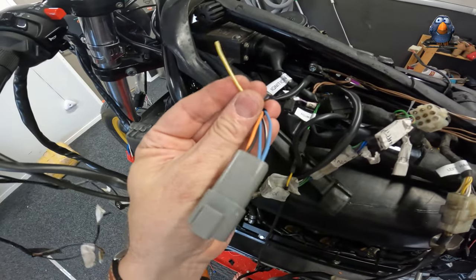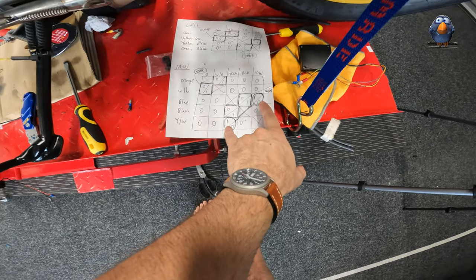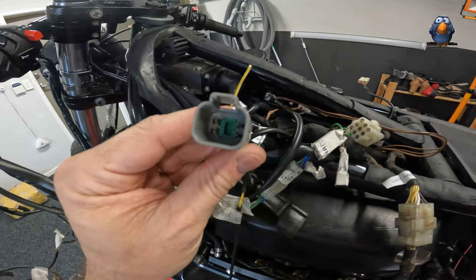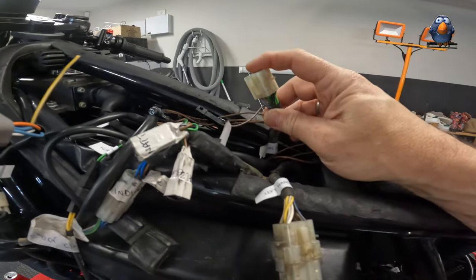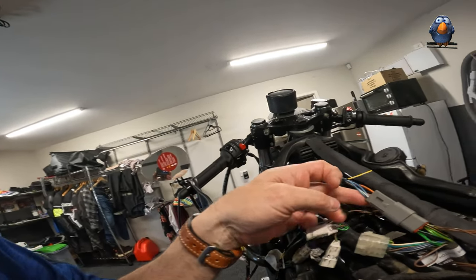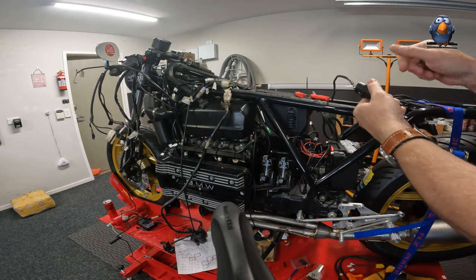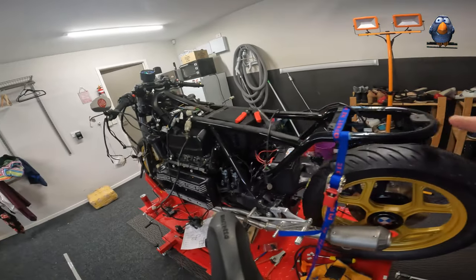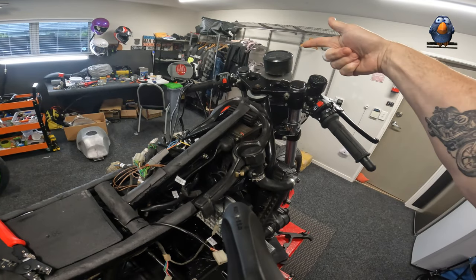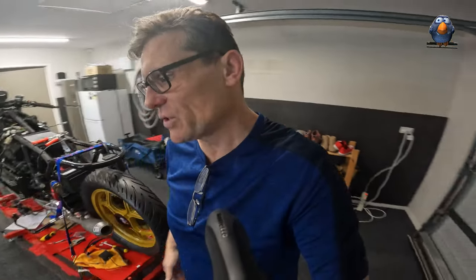The yellow wire has no purpose from what I can tell from the ignition switch - I did all the tests and it's on when everything is off but there's nothing on the K-bike that has that, so I'm just going to leave it out. I'll figure out how to terminate it shortly. The other side requires pulling out a whole bunch of cables - it's pretty tight. There's my new little connector. It starts - you heard it. And if I do that: off, on. It all works! Back on schedule - fuel tank next.